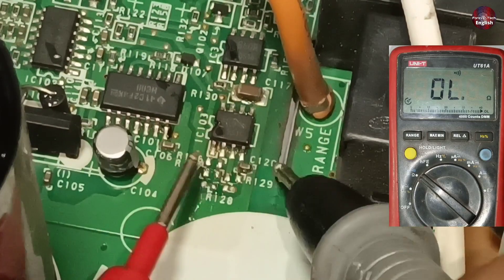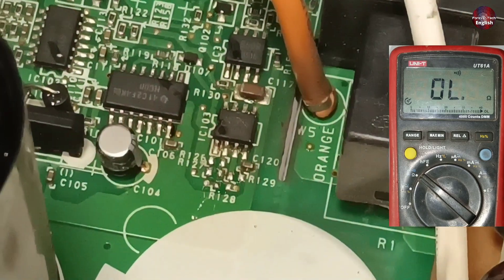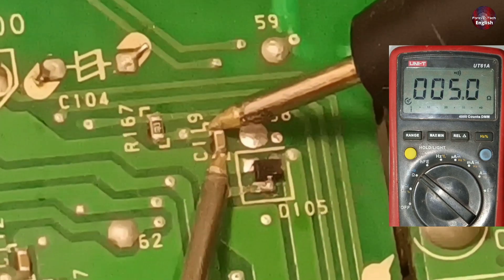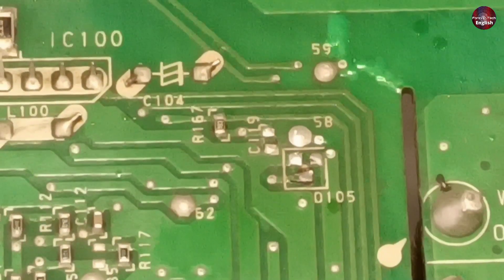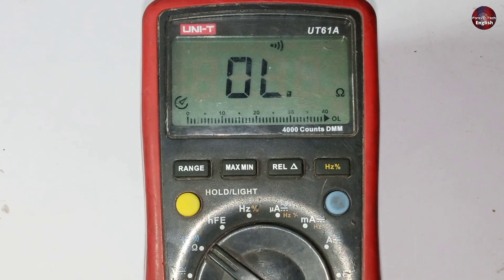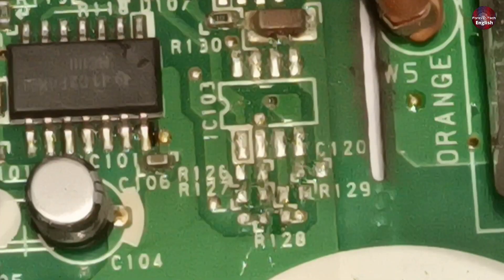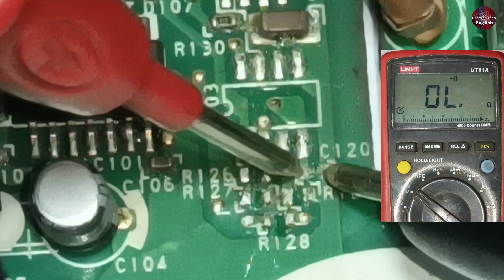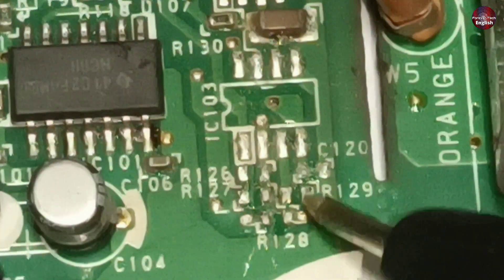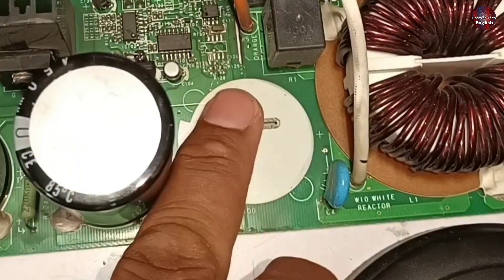Capacitor 120 is also problematic. It is showing continuity but the multimeter is not beeping. On the other side of the motherboard, let's check capacitor 119 — it is a complete short circuit. I removed the capacitor and the diode, but I am getting another issue. These capacitor pads are still beeping on the multimeter. 15 volts pass through this capacitor. Capacitor 120 is also showing continuity but the multimeter is not making a beeping sound. Here, negative 12 volts are made, meaning these capacitor pads have short circuits.